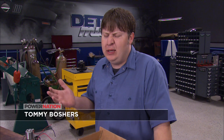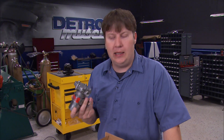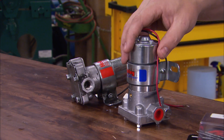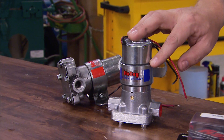First off, let's talk about fuel. Let's say you've got a mildly hopped up small block Chevy, so you're probably going to need a fuel pump like this one. It's referred to as the red pump, offered by Holley. It pumps out 97 gallons per hour and costs a little over a hundred bucks new. This electric pump has a bigger brother often referred to as the blue pump - it's more street strip-minded with a rating of 110 gallons per hour.